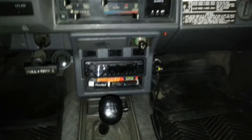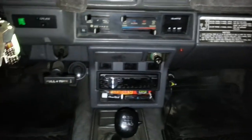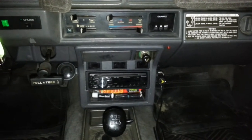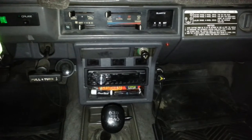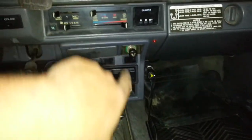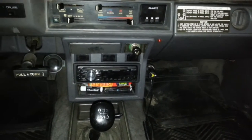I show how I wired them, how I separated them, and then I marked them so that I can easily just pull the radio bezel off and pop and pull all three switches free of their wiring and get them right back on in the same place. I used red, white, and black — red for power out to the relay, white for the ignition power, and black for the ground. They all went to a common ground on the frame there of the whole bracket that holds the stereo and much of the climate stuff together.